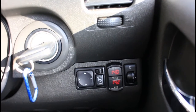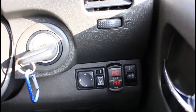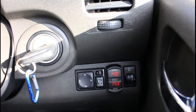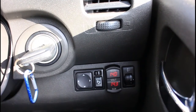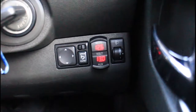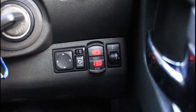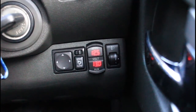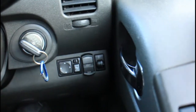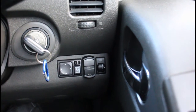So what you get is your auxiliary battery basically only receives about 15 minutes of charge when you first start the vehicle and not much after that. I'll pause the video here, run the car until that voltage drops down, and then show you what happens. All right, you can see the voltage just dropped down to 12.5 and the auxiliary is at 13, so effectively the voltage sensing relay is going to open circuit and the auxiliary battery is not going to be receiving charge.